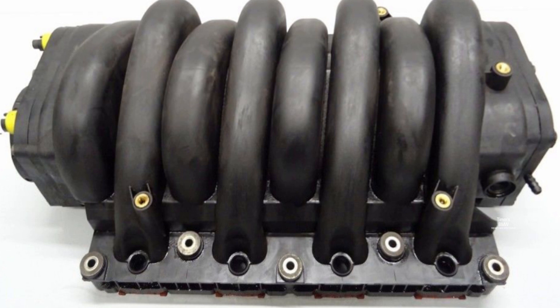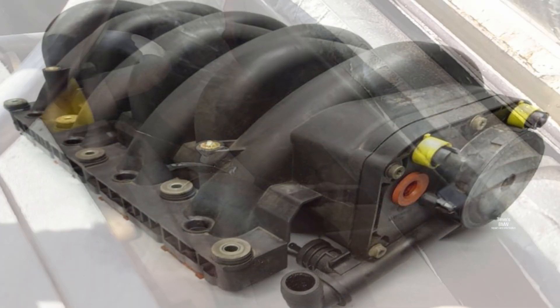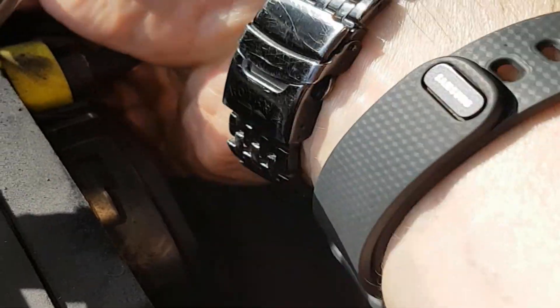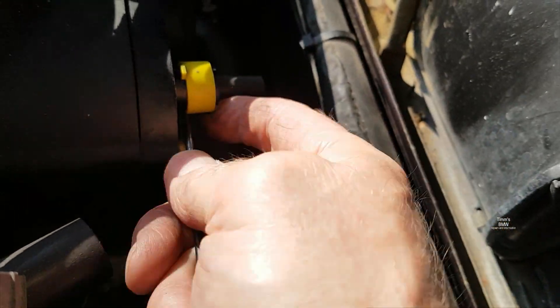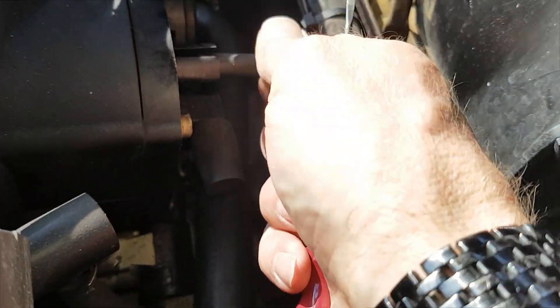There are a couple of other points worth mentioning. The rubber bungs on the PCV valve at the back — the E38 doesn't have any because it uses all the vacuum takeoff points, but on the E31 we've got two of them. First thing we always check is the vacuum line from the PCV — there it is — and that runs to the fuel pressure regulator. Check it hasn't gone hard and has no cracks in it. Here's the first vacuum takeoff point bung — take the collar off and pull it off.